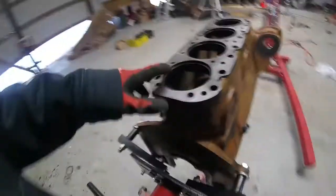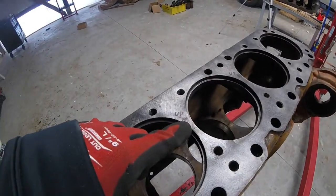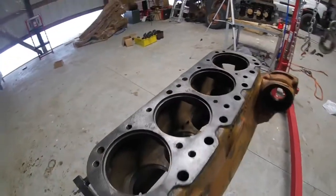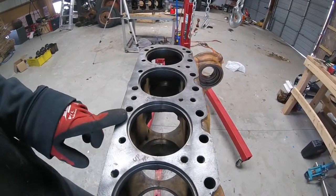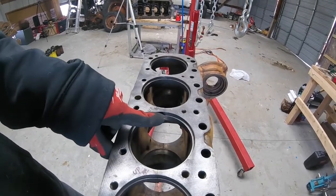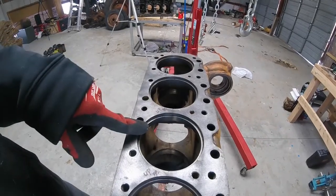So I did some more digging. I put my step mic on this half and measured to the other side of the crack, and we're up between 5 and 8 thousandths. So if you subtract 5 to 8, that puts us in and around the neighborhood of where we want to be. Because this crack is going all the way through, I suspect that it's also pushing up on our counter bore and making the cylinders too high.